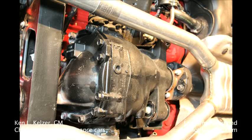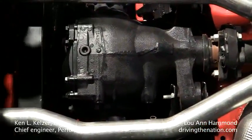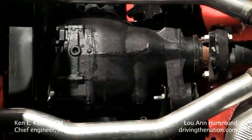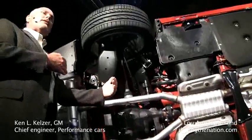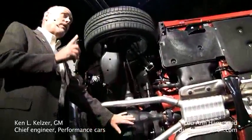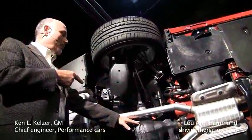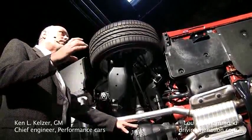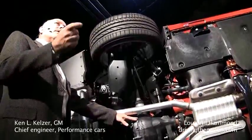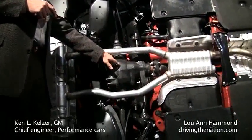Rear-wheel drive differential — what you see here, this is cast iron. A lot of folks will say, why didn't you use aluminum? The reason we use cast iron is we want to balance fuel economy and performance, as well as weight distribution. The goal was to have 50-50 weight distribution, so obviously it helped. But the primary purpose of doing this was because the thermal expansion of cast iron is less than aluminum. If you use aluminum, you have to have a higher preload on the bearings, which in turn reduces fuel economy — and this is better from a noise standpoint as well.